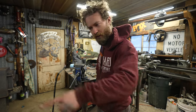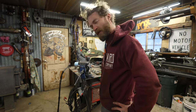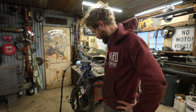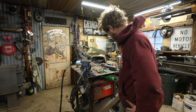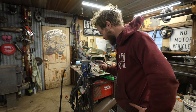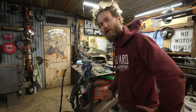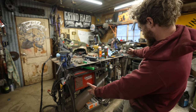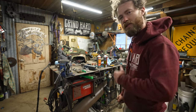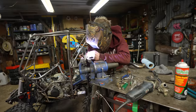All the argon earlier when I was welding things that don't really matter yet. So now we're out. But I have a thought, and that's that it's extremely cold over here. If I take this argon bottle and I put it right next to the wood stove, it'll warm up, which will increase the pressure inside of it. And there can't be anything other than argon in there. It's just that there's no pressure to push it out right now. So there's still about that much argon. It just needs a little bit of increase in temperature. Not much, but there's some argon coming out.